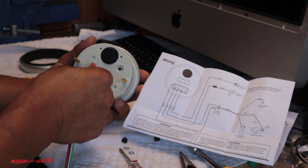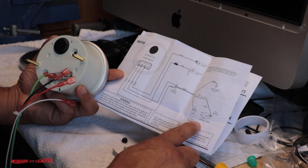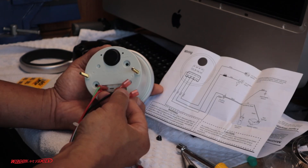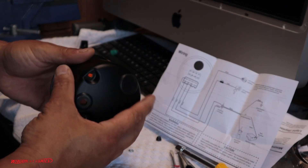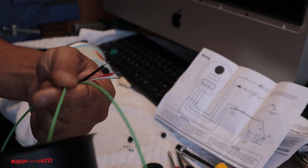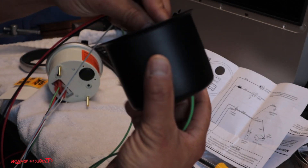It's always easier to do the wiring on the workbench. The green wire goes to the signal — on the back of the meter it says 'SIG' — and that runs out to the negative post on your coil. If you don't have a coil, most ignition boxes have a port for your tachometer. Next is the red wire which is your 12-volt, then the black which is ground, and then the white for the lamp. By the way, the green wire is much longer than all the others because it has to run all the way out to the coil.